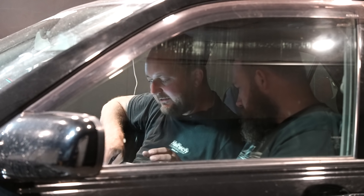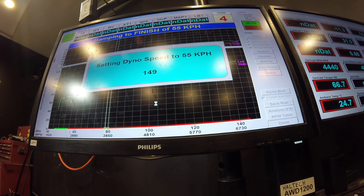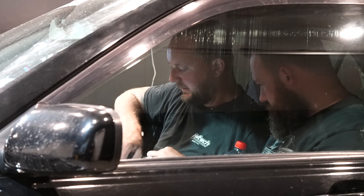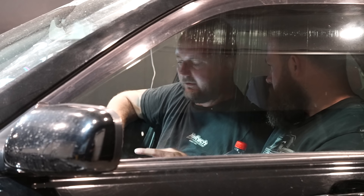Now that it's all back in the right spot, the next thing is to put ignition timing back in again — now that we've done the cam timing, we'll see if it wants more ignition timing. Every little thing, one kilowatt at a time — is it hard to make 100 kilowatts or one kilowatt? Now we're at that point. It seems to have wanted that. Quick health check — look at the mixtures, make sure everything looks all right. The long terms are sitting at minus three percent and short terms are at zero. That tells us we didn't need to massage the VE map at all; we just needed to massage the fueling.